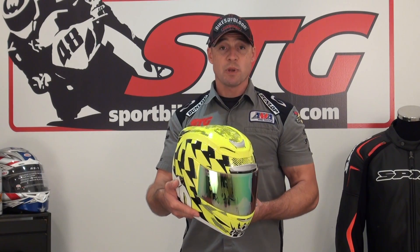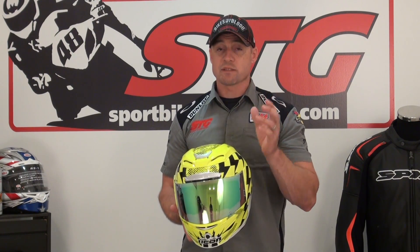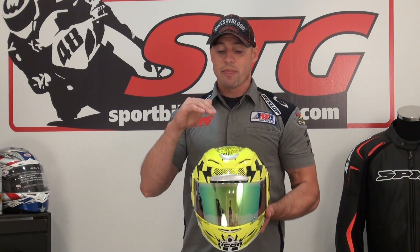If you like your helmet to fit the way I just described, order your normal size — I think you'll get a good fit. If you prefer a little more comfort, a little more operating room, a little easier on and off, you may want to consider going up one size. They are using a polycarbonate injection molded shell, DOT and ECE 22-05 certified. Weight in a size medium was 3.55 pounds on our digital shipping scale, so it's nice and light. This helmet utilizes four shell sizes with five different EPS liners. They also have variable thickness cheek pads and top pads — you can further fine-tune the fit just like you can with an Arai or a Shoei. This is the first time I've seen a helmet at this price point — beginning under $200 for solids and just over $250 for graphics — offer that many different shell sizes and EPS sizes. They do that to keep the exterior profile of the helmet as small as possible, and to really help dial in the fit.